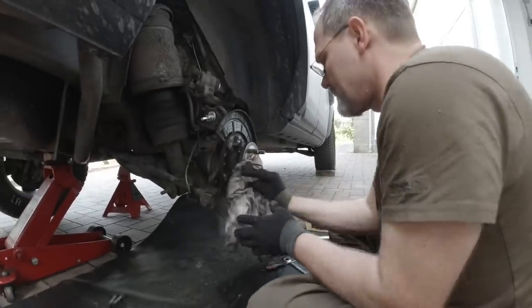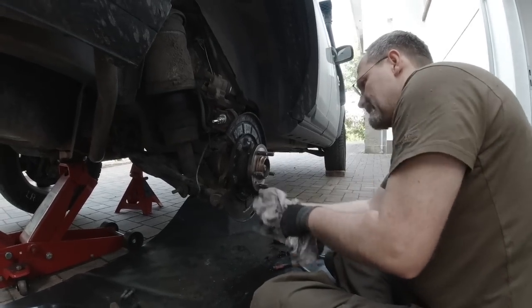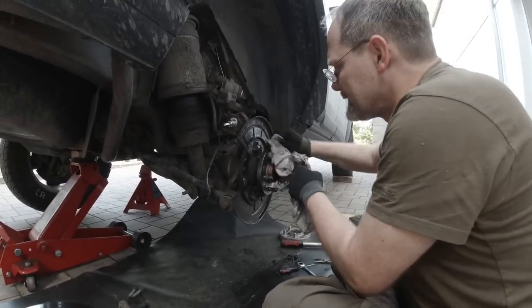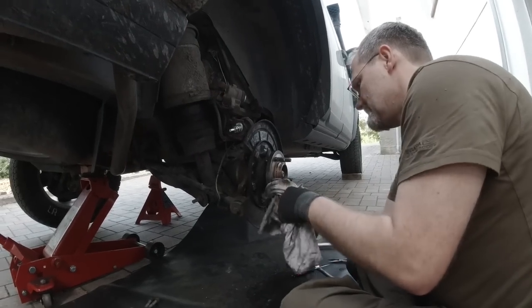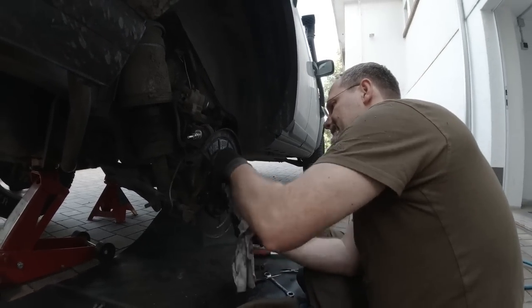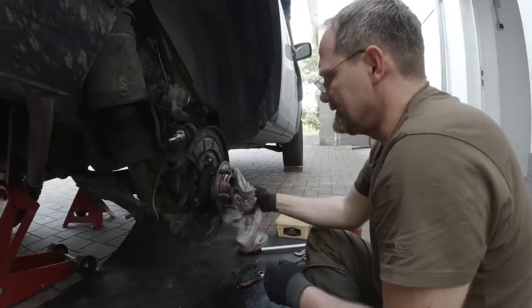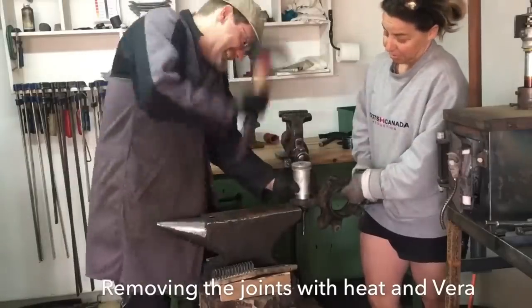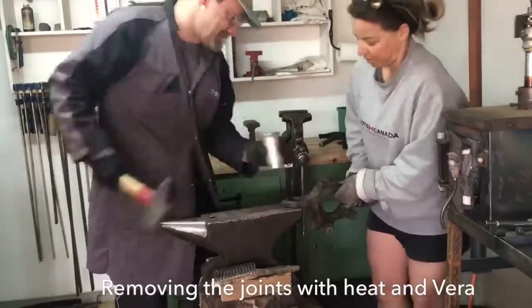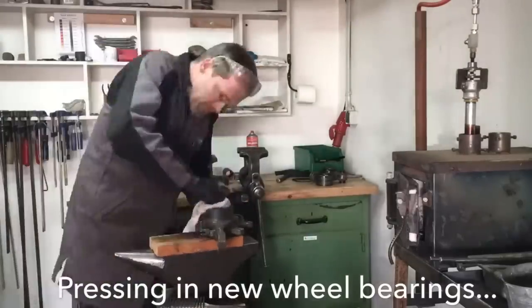Oh, that wheel bearing looks the same like in the front. Yes, this one is a press-in wheel bearing. The front is a complete hub. Oh, do we have a spare? No, the rear is not serviceable on the road. Oh, really? Oh, that sucks. We should replace them then before our next Berg trip. They are new. Like when? Like 2 years ago, our first video, we did the rear wheel bearings. That's when I dropped the punch on your foot.